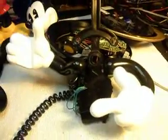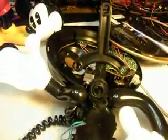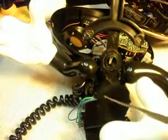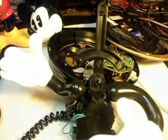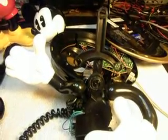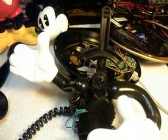I'm going to go ahead and stop it. So now we know that the bracket for the head that takes it on down into the gearbox, and the guide that was broke, have been repaired. You can see that it's working now. And under normal usage and normal conditions, you shouldn't have to worry about the guide breaking again.